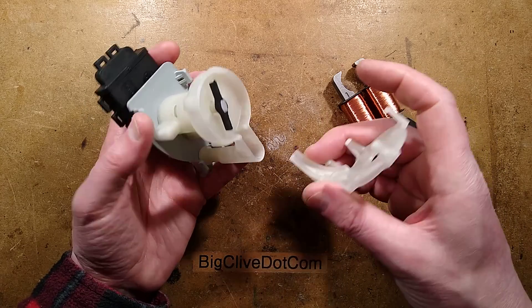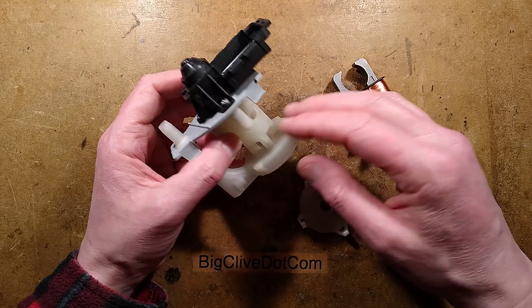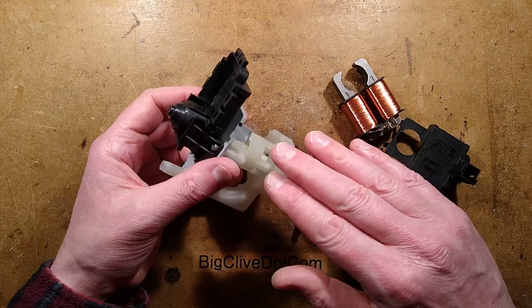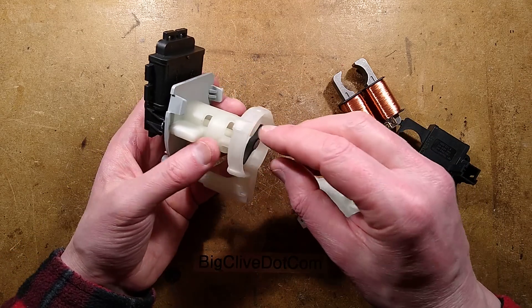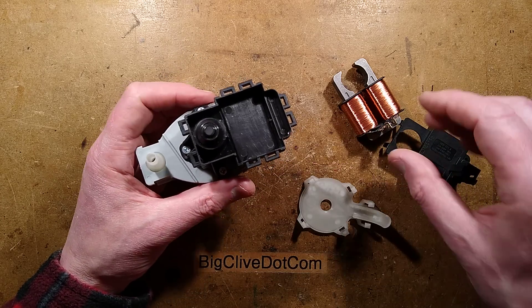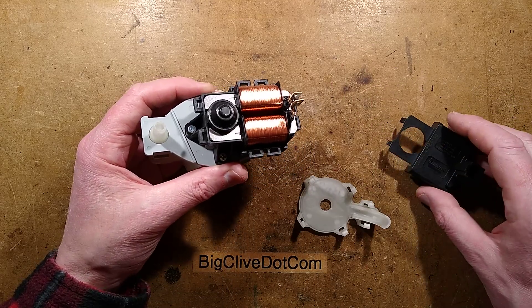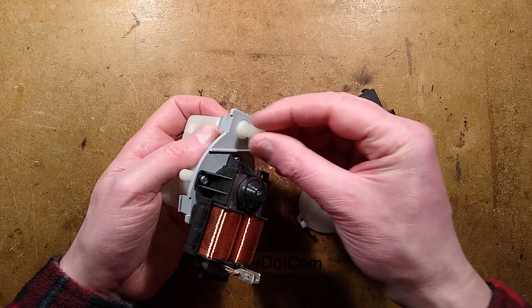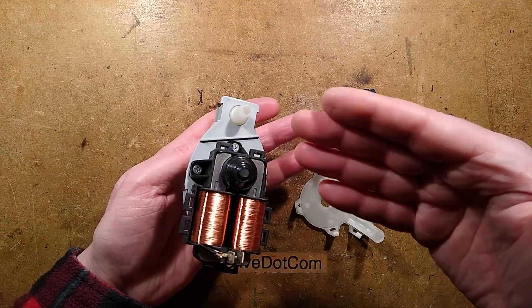When it goes together, this just slides in and clips on. The water finds its way in over the top of the pump through this channel. It's worth mentioning that because they've kept the motor above the height of the water, with a long shaft coming down, water can't theoretically get into the motor. Very interesting, very minimalist design — not surprising given the market it's aimed at. The water comes out here, goes to the top, and if it overflows in the collection container, it comes back down to the sump again.